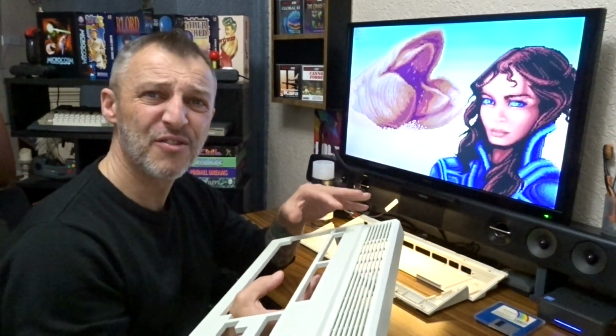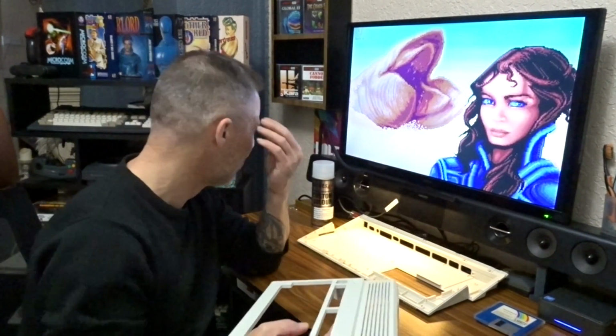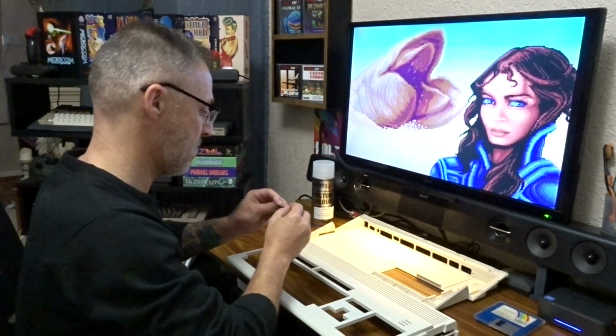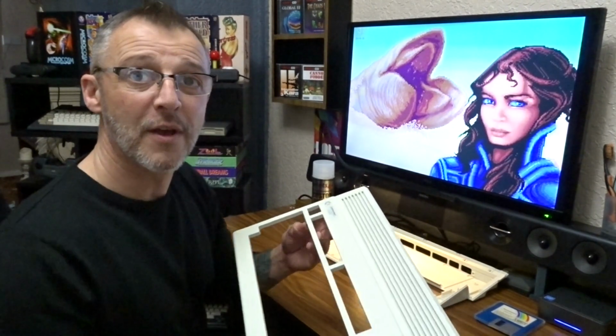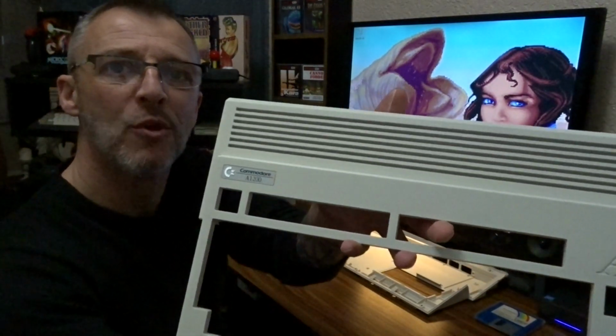The difference between this and retro brightening: sometimes retro brightening can come back, especially on the keys. The keys are renowned for it. Painting it this way won't make a difference. It'll stay like this permanently. Alright, now put the badge back on. You literally can't tell it's been painted. There we go, all badged up.